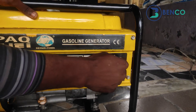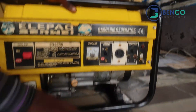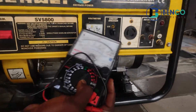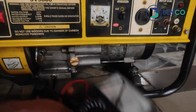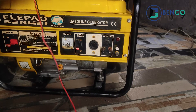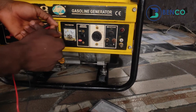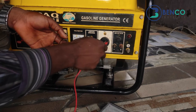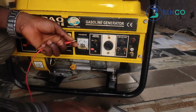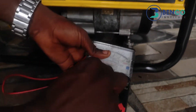I actually checked the pilot lamp here to see if it's going to at least show any light, but nothing showed up. I equally tested the sockets to see if it's going to read via this meter, but nothing happened. Before I continue, I will equally check the continuity of these sockets — to see if, for example, the wire connected to this particular socket is discontinuous along the way, meaning if there's a break somewhere. So this meter will show us if there's something like that.